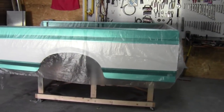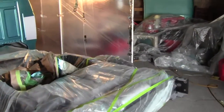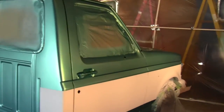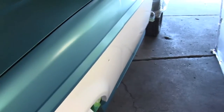I've got the box under plastic and I've been painting the truck, which you can kind of see through there. Last night we started using some Rust-Oleum automotive tape - don't get that stuff. It's this orange tape that says 'automotive tape' by Rust-Oleum. When we took it off, it left a residue line all the way down both sides of my truck, right in the middle there. The residue off that tape didn't let the paint stick on the first shot. Other than that it turned out pretty darn good.